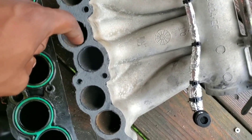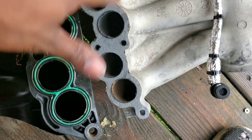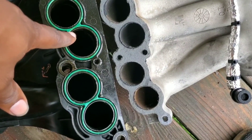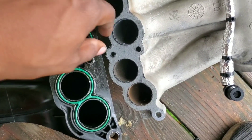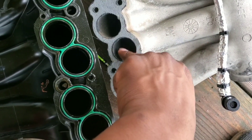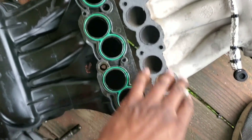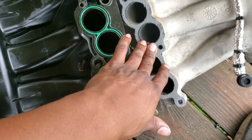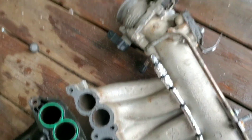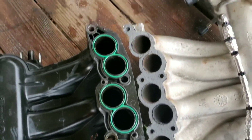With the 60 millimeter and other advantages — these runners are about the same size — but this metal one you should be able to port out a little bit more than the composite, because there's very little plastic to work with. I can actually port this one more because it starts off big up here and narrows down here, so porting it should make a higher volume runner. I probably won't be doing this today though — I'm just looking to install it. I won't do any porting today because it took a lot of my porting bits just to get that throttle body on there, so I'll save that for another day.